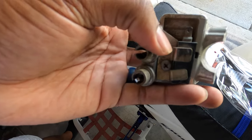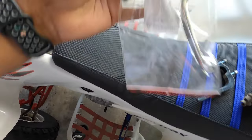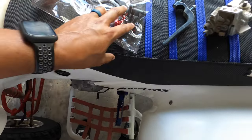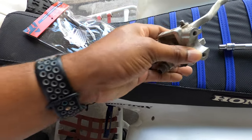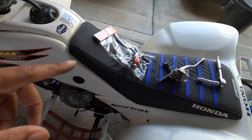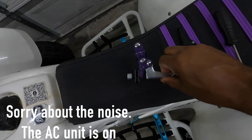Once that's out you are good to replace it. If you still have your clutch bypass hooked up, note that this Tusk lever is not compatible with the clutch switch on these bikes. To bypass it, take those two wires and connect them together. Be careful though, because that means your bike can start in gear.